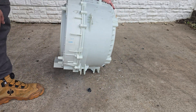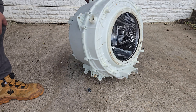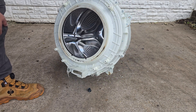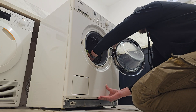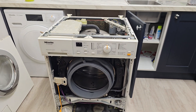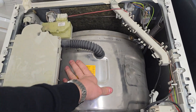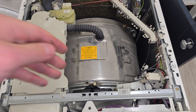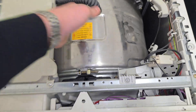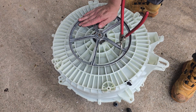When it comes to tanks, there are primarily two different versions in front-loading washing machines: a split tank and a welded tank. The only exception is Miele, which uses a fully stainless steel tank all the way through — it's one of the reasons why they're a cut above every other manufacturer. We've got a comparison video where we take a Miele and compare it against a cheaper machine. This is a split tank, meaning we can split it apart and replace whatever components have failed.